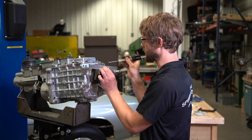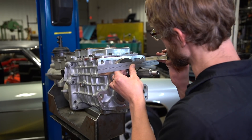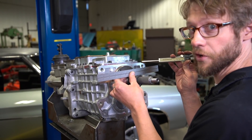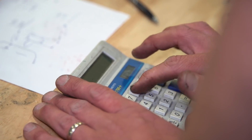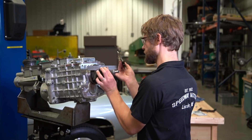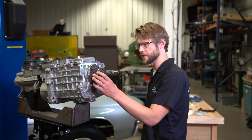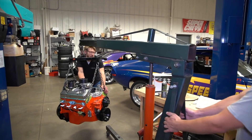I'll typically verify my measurements with a straight edge and a caliper so you can be a little more precise. The thing to remember when doing it this way is to subtract the thickness of your straight edge — if you don't, you'll be all screwed up. What we've got here after working this all out is exactly 150 thousandths, so this should be about ready to go. We've got to hook up our fittings for the bleed and for the pressure from the master cylinder, and we're just about ready to drop it in.